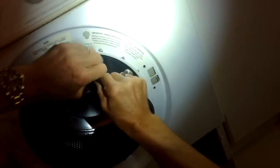And now there's some electrical connectors on the right side of this that I have to reach in and undo. This ended up being one of the older style ones, which are pretty expensive and a little harder to replace, but I'll just show you guys. So the upper side of this on the right, I got 2 spade connectors I have to reach in and pull them off one by one. So I'm going to grab them and wiggle them, pull them out toward my right so they come loose.